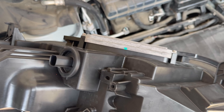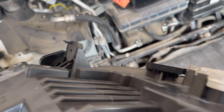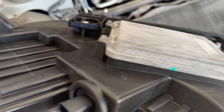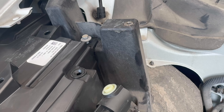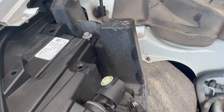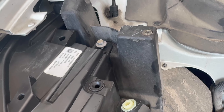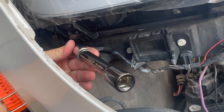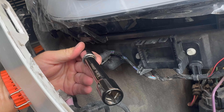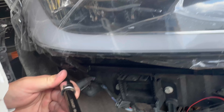I'm holding the right one in my hand — I just thought I'd show you guys those lower locator pins. You can see that fin pin sticking out there. You want to get those lined up first before you start cranking anything down. The other thing to mention is you want to get all of the bolts in there finger tight before you start cranking anything down. Turn them a few times just with your fingers to get all the holes lined up, because if you start cranking with a wrench or ratchet, you're going to run into alignment problems. For these lower bolts, I'm using a big extension with a 10mm on the end, just to snug it up — but we don't want to snap the plastic.